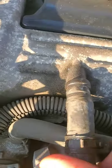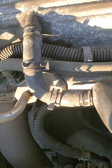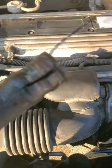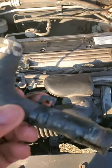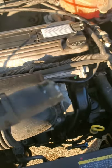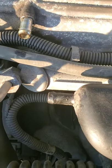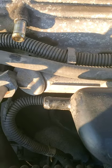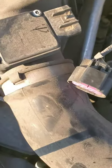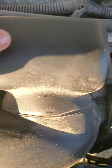I'm going to remove the hose completely so I can inspect it myself. Look at that — this hose has got to go, it was already worn. That's why it's best to just take the entire thing off and check it yourself. But if you feel like your hose is in good shape, you could just remove one of the clamps and slide one end of the hose off. Since the clamps are loosened and the mass airflow sensor is disconnected, go ahead and pull up — it should come right up.